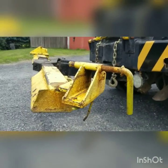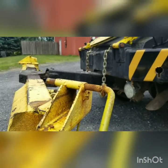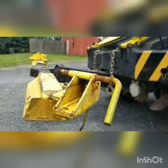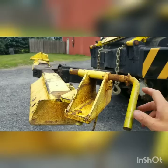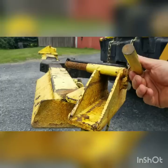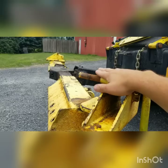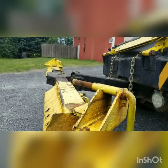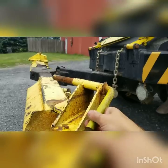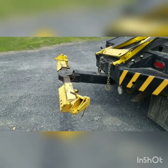The second thing I noticed is a lot of people cut this bar off. I know this bar can be a pain when you're hooking up to the car — you can hit the bumper with it — but what this bar does is, once you've got your car set up, you put it in place just like that, and it prevents the car from shooting forward and into the back of your tailboard. So don't remove those.